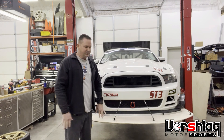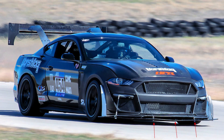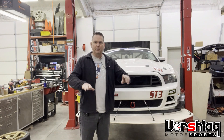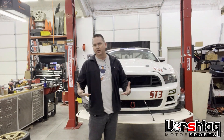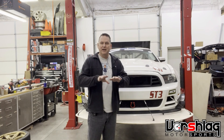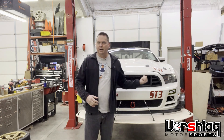For fore-aft, there's a lot of bowing we've seen. You can see it when the main splitter itself starts to bow at high speeds. We've got pictures of Trigger where we were getting a lot of bowing — it was bowing about 2 inches and scraping the ground in the middle, and that's not good. If you could make a flexible splitter that did that, it's not really practical, and it was starting to damage the splitter. We added some inch-and-a-half-by-eighth-inch wall thickness aluminum angle for fore-aft stiffness.